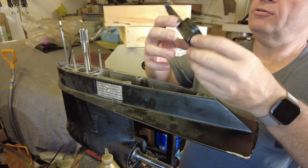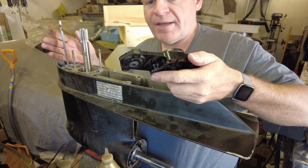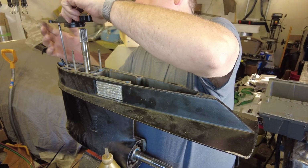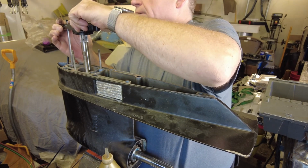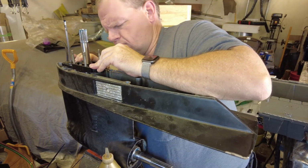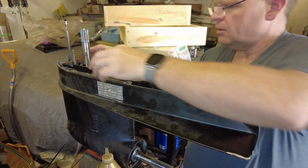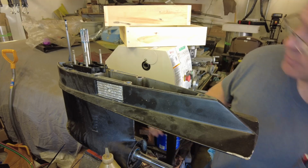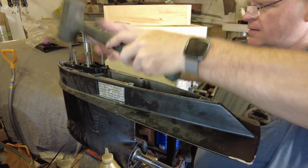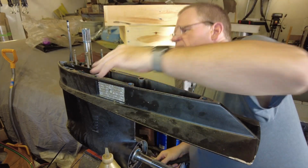Okay, we'll give this 10 minutes or so and should be tacked up enough. The reason we let it tack up is if we just put it down when it's completely wet, it will just smush out and not actually do anything sealing wise. Mostly down, a little bit stiff, but seating, that last little bit. Okay, just a little tap. I don't want to get too carried away. There we are, we're seated.